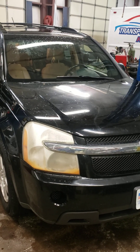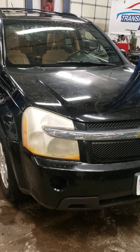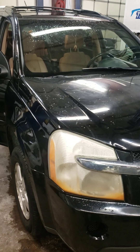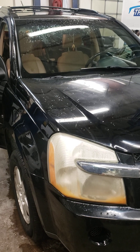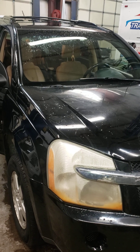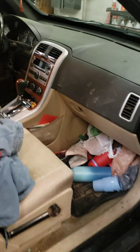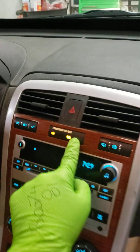Hey, just wanted to make a quick video for a fix. If your car is having an airbag issue — mine specifically had a B0074 and a B0081 on a 2007 Chevy Equinox — it is the passenger presence module in the passenger seat. It just wears down and breaks somewhere internally, or the wires are frayed. This causes the airbag sensor to not detect that someone is sitting there, and when it doesn't detect that, the airbag light will always go off.